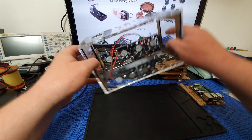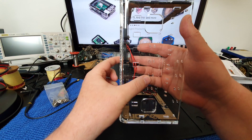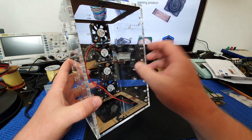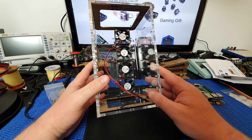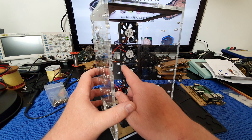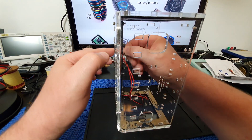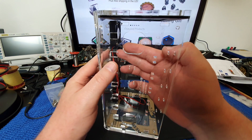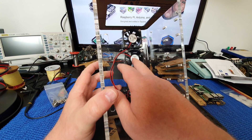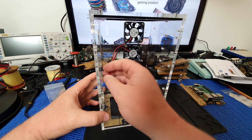Inside the case also come four fans. You need to find the 20mm — or three-quarter inch — screws that go inside. I'd probably know them as 2BA or 3BA, but they are 3mm diameter screws, 20mm or three-quarters of an inch long. They bolt the fans on the inside. The fans go through so the cables are on the inside. These will only rotate one way and I think it draws air out — anyway, that's the simple part of the fans.